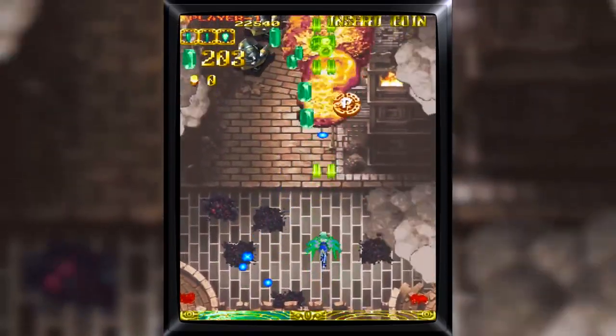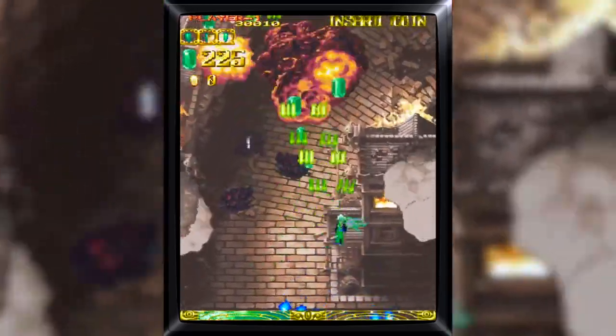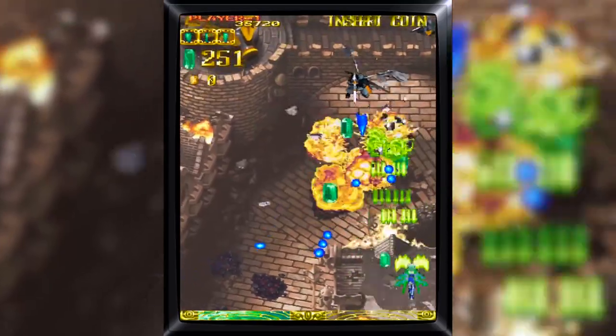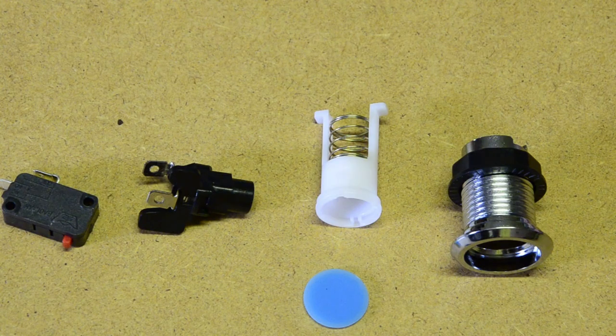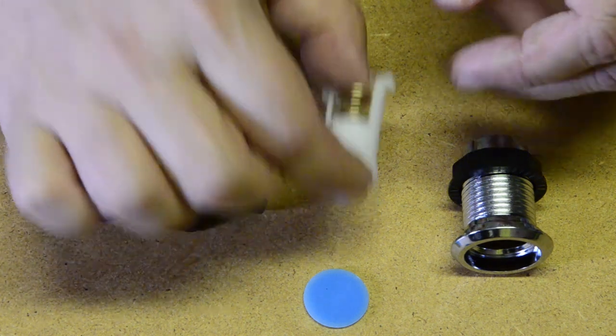Naturally, for an action button you would choose a lighter weight ranging from 50 to maybe 90 grams. A more functional button will sooner have an operating weight of 200 to 250 grams, which will make them last for a long time, but they're also louder. Let's now look at the other important component: the plunger.